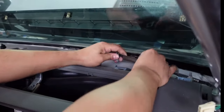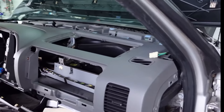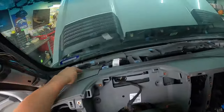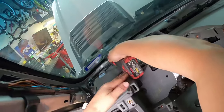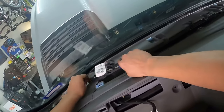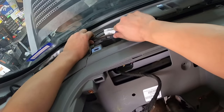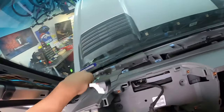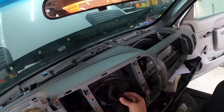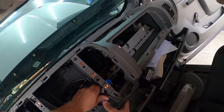This is our antenna for the radio — just pull it apart. We just got to do that last 10mm and disconnect our cables over there. We got one more 10mm right here. Then grab our pry tool and disconnect our connectors. Since the dash is messed up, we want to be very careful pulling this dash out so we don't cause any more damage. Get our cables loose, make sure we got everything loose, then push our wires back into the dash so they don't get caught as we pull it out.